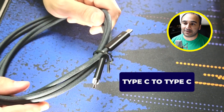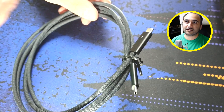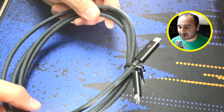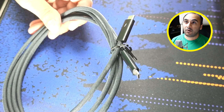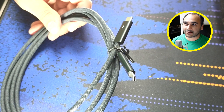What I should be saying is Type-C to Type-C — that's really what this connector is called. It's called a Type-C connector. USB-C just happens to be the USB version of the Type-C connector, which is exactly the same but maybe made to slightly different specifications. This cable can also do power delivery, and I think all the Thunderbolt cables can do power delivery, but USB ones won't unless they support USB PD — USB power delivery. That power delivery is up to 100 watts, and it might be more with Thunderbolt 4.